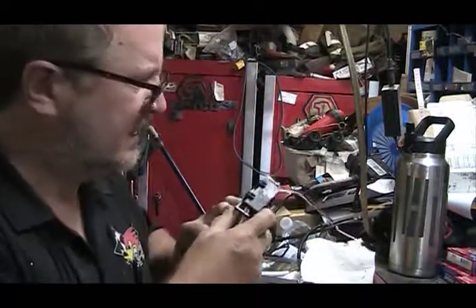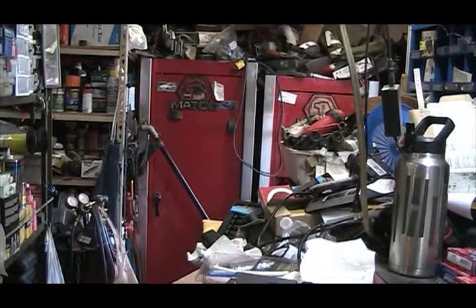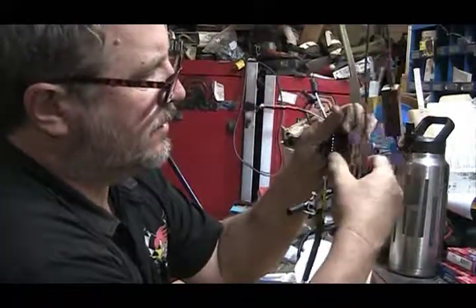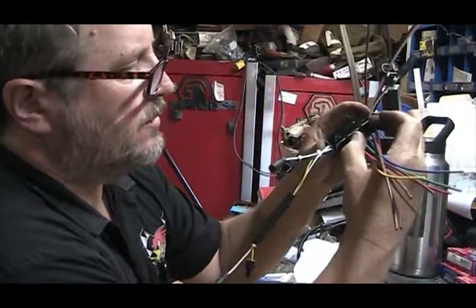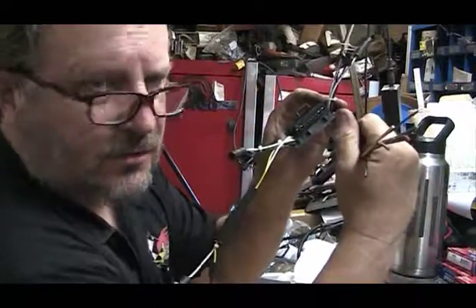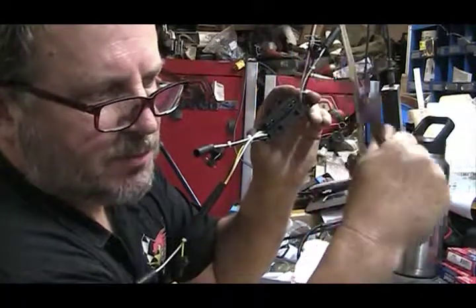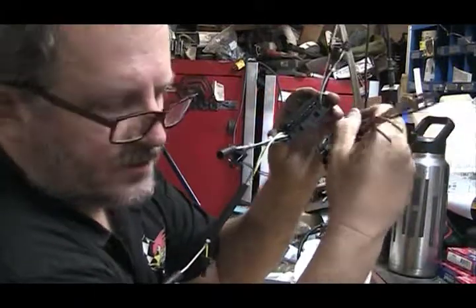Basically, we've got a recap of what we did with the plug connector. These are the new harnesses that you get to plug in. This is the under-valve-cover harness, and it just plugs into the valve cover gasket. I put the buttons in the middle to turn each cylinder off individually. Each button is normally closed, so when you push it you create an open. You can push each button and feel — seat-of-your-pants type feeling — and you can tell there was no difference in cylinder number five.